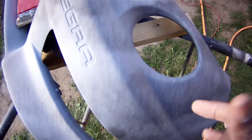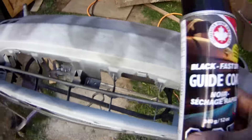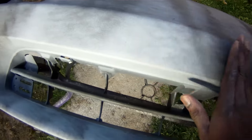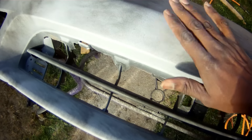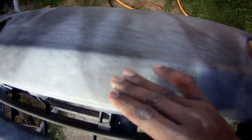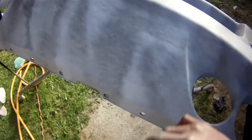I've done all the sanding. I put on build-up primer — I'm not sure if the primer was too cold but it's actually giving off little spots, so I have a little extra sanding to do. Then I use what's called a guide coat. Pretty much what this does is make all the low spots visible — if I pass the sandpaper over this you'll see a sink where it hasn't been touched, so I'd know that's where I need to sand and fill. But I'm probably not gonna do more filling; I'm just going to sand it down and paint it.